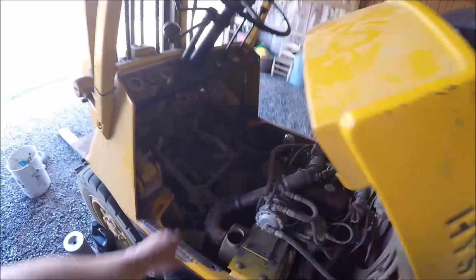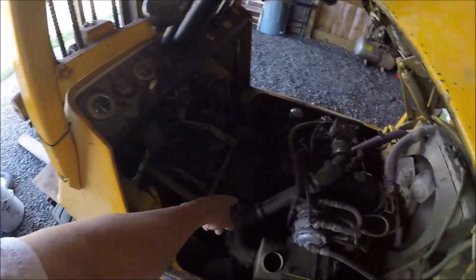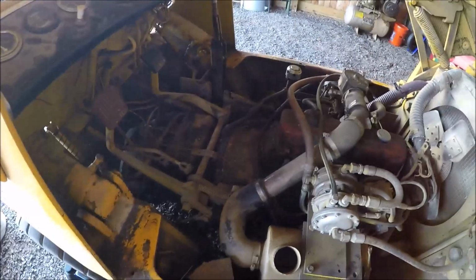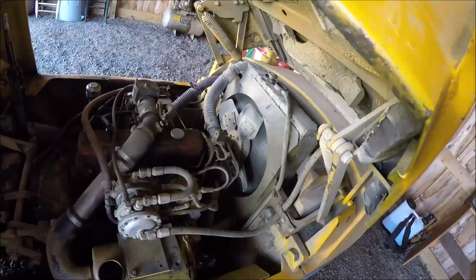And, you know, cleaning up some wiring. It's got a mechanical oil gauge, so I want to change that out and get rid of that plastic line there, because that is always known for eventually drying out and breaking and shooting hot oil everywhere. And I want to blow the radiator out and get all that dust and stuff so it breathes good. Nice thing is, it did come with a new tank.